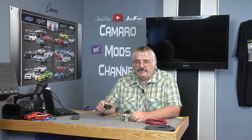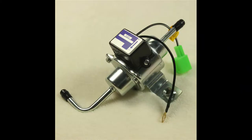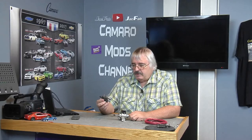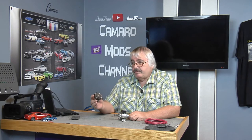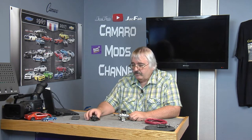If you're having fuel problems like I am with a vacuum fuel pump, it might be time to change it to an electric one. Some days it works fine, other days it doesn't work very good at all, just like you're running out of gas. I've changed vacuum fuel pumps before and actually made it worse. I put a new one on and it actually made it worse, so I switched back to the old one. So I'm just going to go with the electric fuel pump.